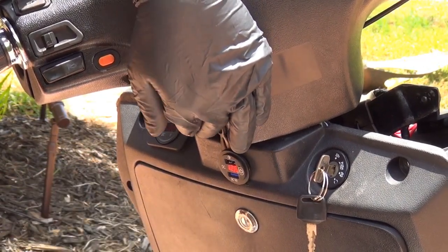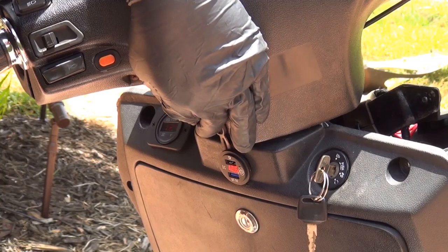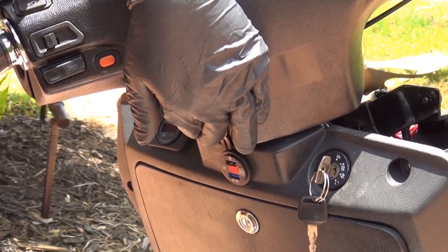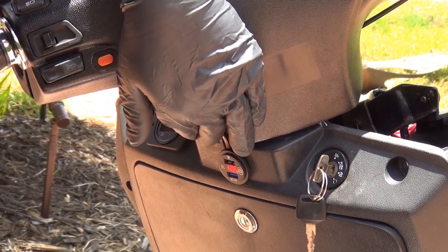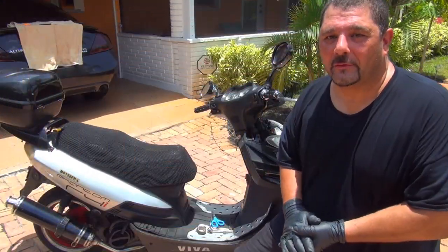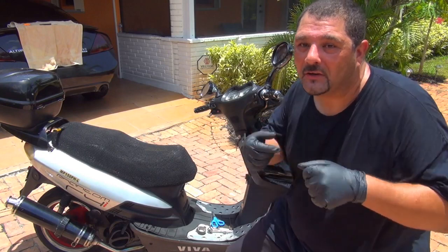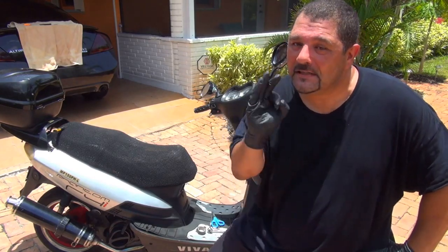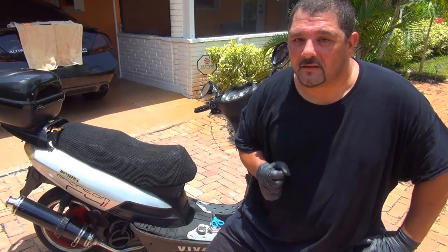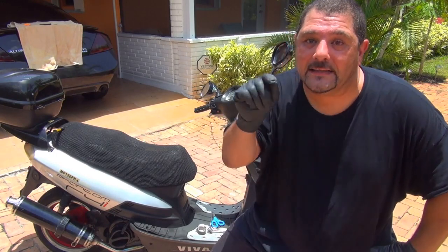If you're seeing a number lower than 9 volts, you have a problem on your scooter. You really want a healthy scooter with a voltage of 12.5 volts and above — nothing lower than 9. Right after you test your USB charger, you're able to put back the nose of your scooter, close everything up, and you can go ride and charge your phone at the same time. Thank you very much for watching — please be safe, contact me if you have any question, subscribe to my channel and click that like button. Have a great day, bye.